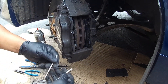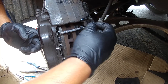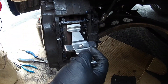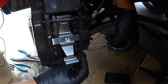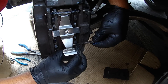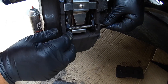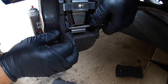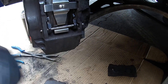Now these pins are cleaned up. I am going to put a little bit of silicone on them to help the pads slide along them. It is just a matter of lining everything up and making sure that your hole is facing out. Then we are going to bring in our spring, bring in our other pin, kind of line everything up again — first through the first brake pad, bring the clip down, you can always push on the clip to make it a little easier, going through our second pad. Make sure our hole is facing out, which it is.